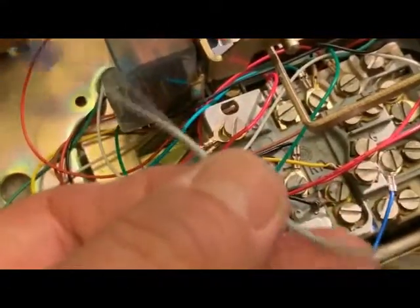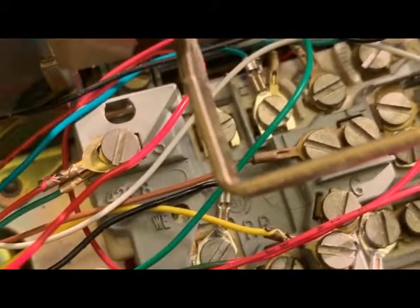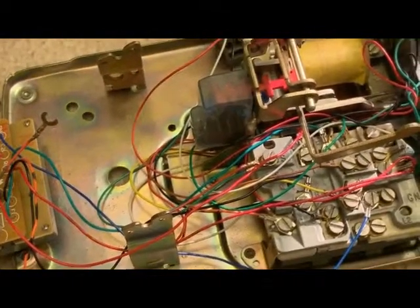I've already tested outgoing and incoming calls — both working fine. Now the cure for the audio problem is a small jumper wire. Get yourself to a hardware store or electronics supply store and make a little jumper. Connect one end to the S terminal and the other end to the GN terminal. As soon as that's in place, you'll get plenty of audio. This is a great project — a heavy-duty phone for not much effort. This one was $15 plus shipping.